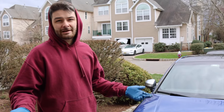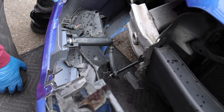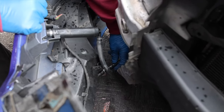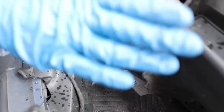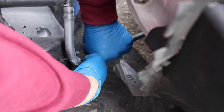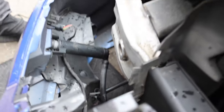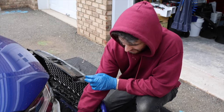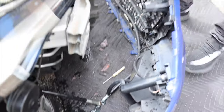Now it's sunny again, so we're making our way back outside. I have headlight washers and the full front PDS system, so I need to transfer all that over. I'm going to take the line from the washer reservoir assembly and plug it to get as much washer fluid out of the system as possible. I'll use an oversized bolt — it fits in perfectly. Just be careful of the plastic tab right there so you don't break it. We'll use some hose clamp removers to get that out of the way. Got the bolt in, made a bit of a mess, but now we have more access.